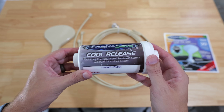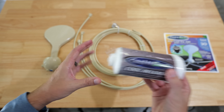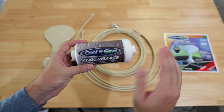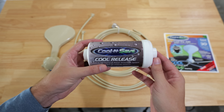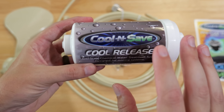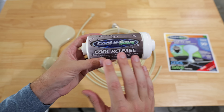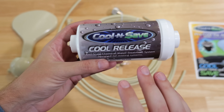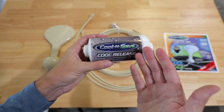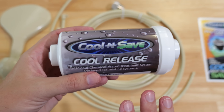There's also this filter, which they say is about a three-month filter. In the wintertime, you obviously won't want this installed because you don't want water spraying onto your unit and freezing. This filter is designed to remove scale — those mineral deposits found in a lot of water — and helps with hard water. It would really help to have a water softener in addition to this, because if the water is too hard, it can do some damage to the unit.